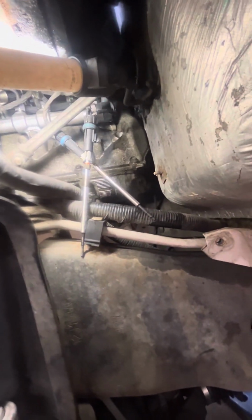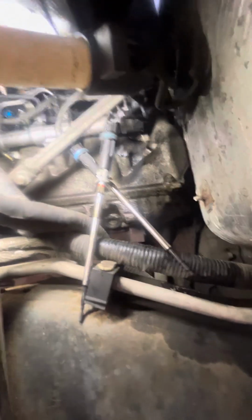You sit and look to see if any fuel will spray out. If fuel sprays out, that means the injector in that respective cylinder is leaking. So what's happening is, as the fuel pressure is building up, the injector is leaking it back out. And fuel pressure is never good enough to build up to 5,000, so the injectors are not going to come on, and the truck's not going to start. So I'll show you a demonstration on this.